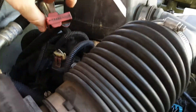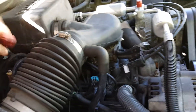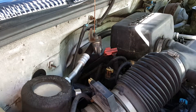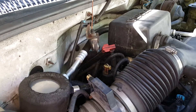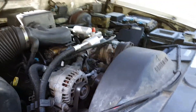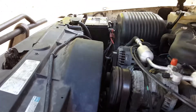Over here we're going to come to the transmission oil. To check this, you're going to want the engine running — so I'm not going to do it right now. It's also a dipstick, and this is only on early-to-mid 90s models. Transmission fluid is a reddish color, so if you're ever leaking a red fluid from your car, it's almost always transmission fluid. On newer mid-2000s cars, there's no way to really check your transmission fluid other than taking it into an oil change shop — they seal off the transmission. The best way to check it is while the car's running on a flat surface — put the car in park, then drive, then let go, and then put it back, so it kind of goes through each gear.